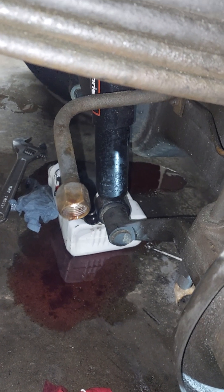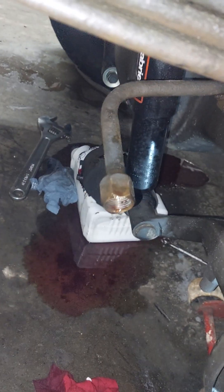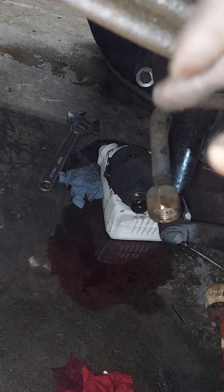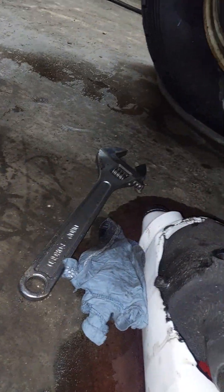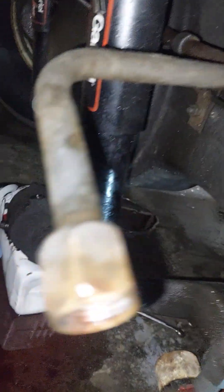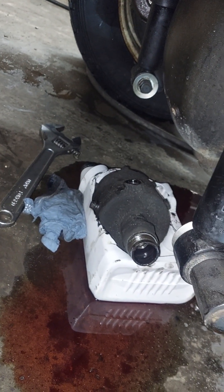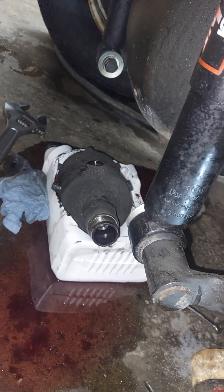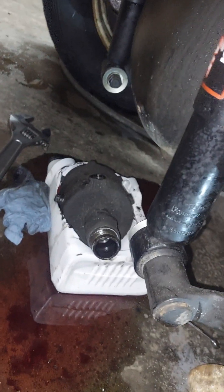This system runs off your hydro boost on your motor via this line here. You actually have to bleed this system too. There is a bleed screw, but there's a large nut — I had to use an adjustable wrench. You take your fitting off, there's a 90-degree elbow you take off as well. You unhook the line and spin off the bleeder screw after you cage the brake, because if you don't, it'll shoot across the shop.